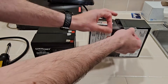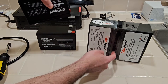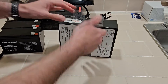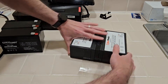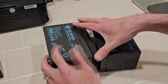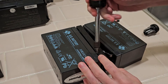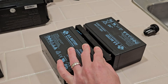What you need to do is remove the tape from the original battery and this little connecting piece, and you will basically wire these batteries together, reuse this connecting block and the tape, and then you've built your own replacement battery. The first thing to do is remove the tape that holds the two batteries together — peel it off all the way around, and we are going to reuse it. Put it to the side and take these two batteries apart. They are stuck together with a little double-sided tape on both sides. You might need a screwdriver to help pry them apart.